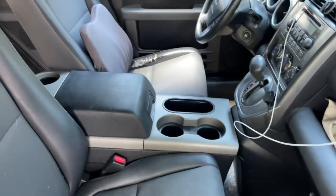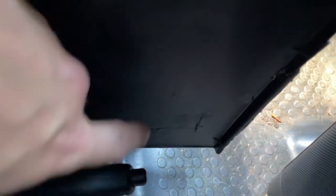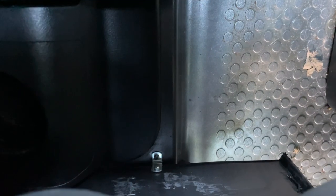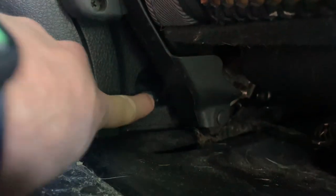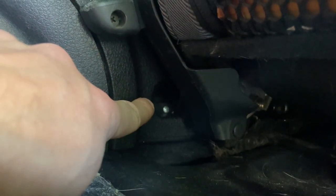It fits in fairly well. I just had to cut off all of the — you can see some plastic residue here — there's a bunch of clips when you get it. Every single clip had to be cut off with an angle grinder or an oscillating tool; I just used the oscillating tool. And then, as you can see here, I installed two L-brackets on the bottom of the silver brackets there into the floor of the Element.